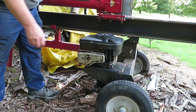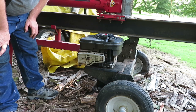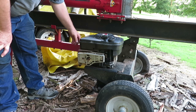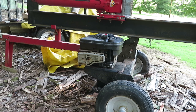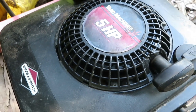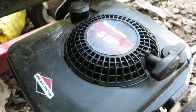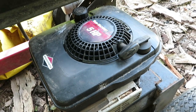Alright, the big test — let's see if she's gonna fire up. It sounds like it's missing just a little bit there. It might need a carburetor cleaned but it is gonna run. It's a lot better than what it was for sure. Now, this process can be used — this is the same as a lawnmower motor. It's just a little 5 horsepower Briggs & Stratton motor. Nothing to it. But we got spark. I did put a little gas in it and everything. I might have a little dirty gas but I'll get another cover for that plug wire. At least it's running — that's the main thing.